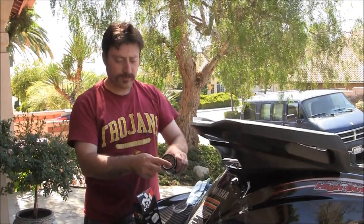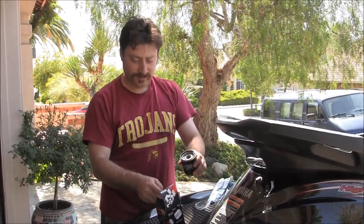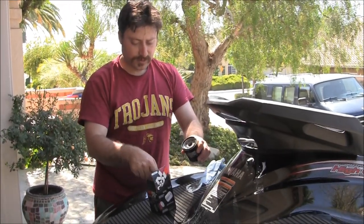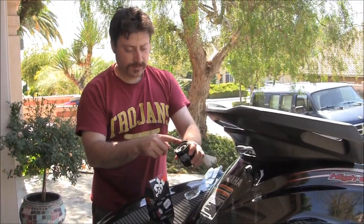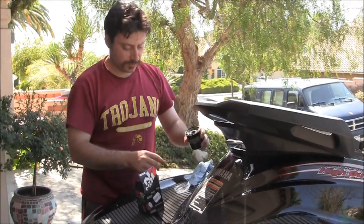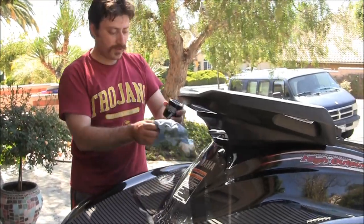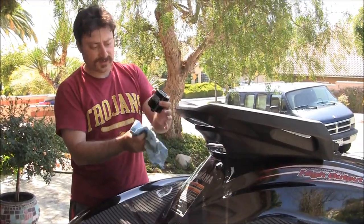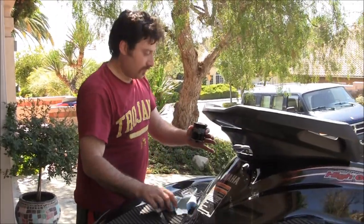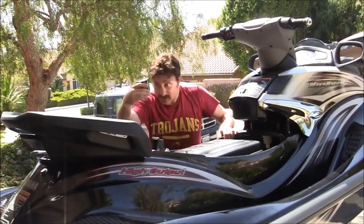It's already got some oil over the o-ring but it doesn't hurt anything. Put your finger into the old oil filter and rub a little bit of oil around the o-ring. Now this is my jet ski — my wave runner. I'm going to torque it down. I'm going to go get my torque wrench once I put it on by hand, set the torque wrench at 17 newton-meters and do it that way. Per specs.